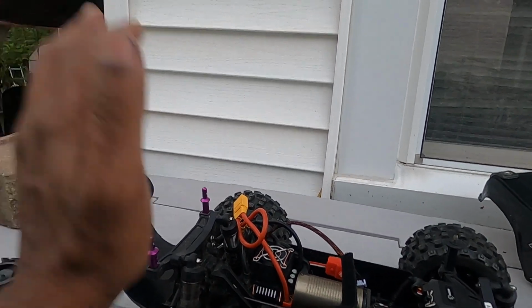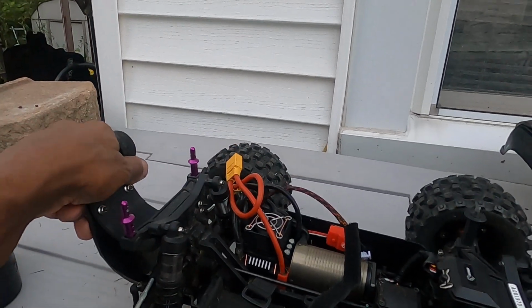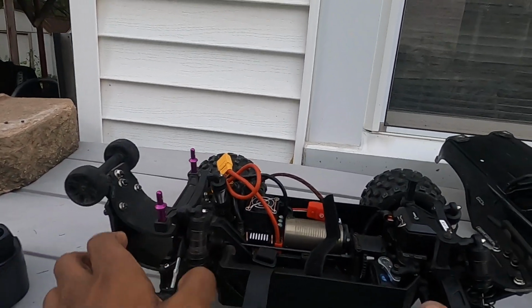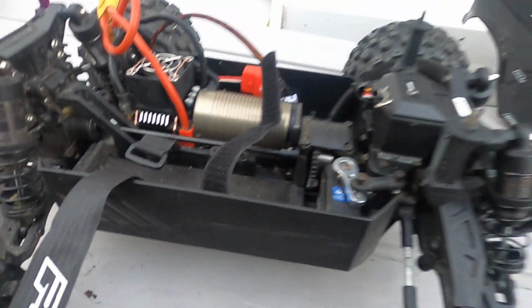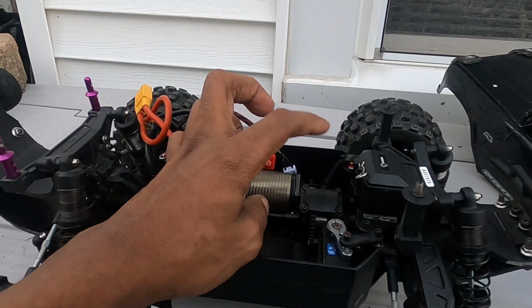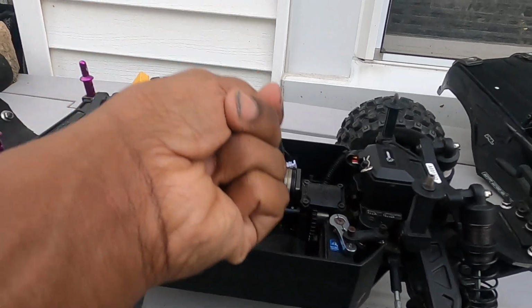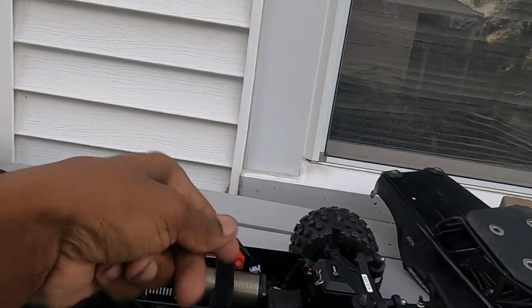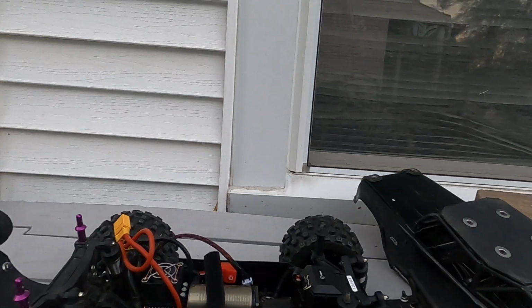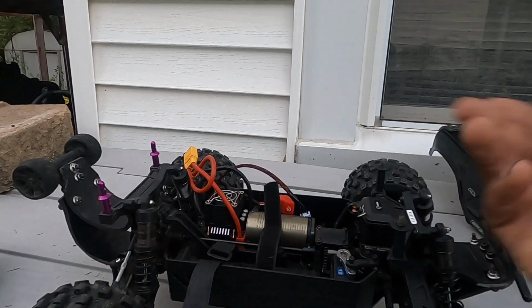This thing really does take a lot of torque when it's moving, and it's actually easy to work on. Except for that stupid inch long dog bone that's up in there. It's almost possible to just remove these four bolts and lift the center diff out. If it wasn't for that inch long dog bone, you have almost no give with that thing. So you have to unbolt the whole front end. You have to unbolt it to pull it away to get the center diff up.